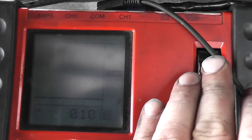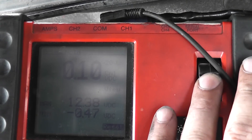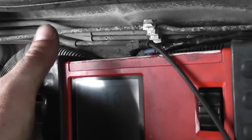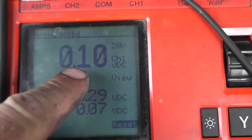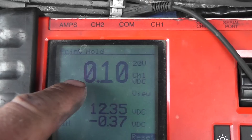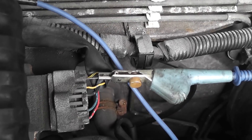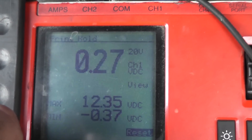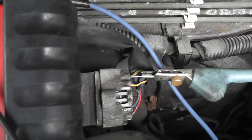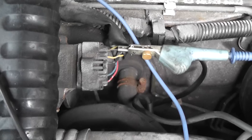I'm going to show you what this would look like if all you have is a voltmeter, using digital mode. If you use a regular multimeter you're not going to have this kind of sensitivity. Go ahead and crank it — you saw like an average of two volts, which tells you there's activity there. Crank it one more time — around two and a half volts during cranking. That square wave activity tells you that you can in fact do this test with a regular multimeter.